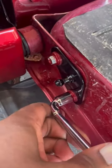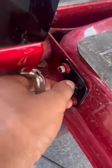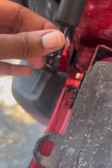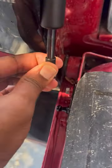You want to install the lower ball mount plate or elongated hole lower mount plate. That's optional. Then tighten the existing bolts with a 10mm socket wrench. Press the mounting ball into the mounting bracket by using your hands or tap lightly with a small rubber mallet.